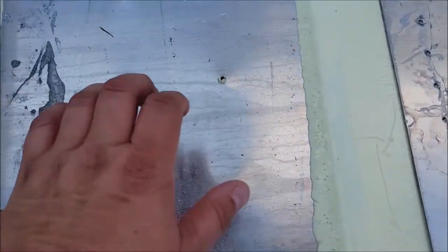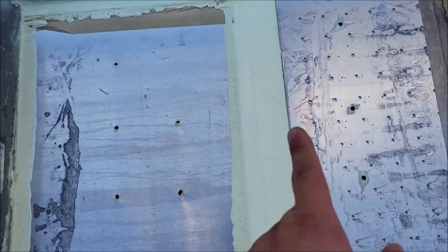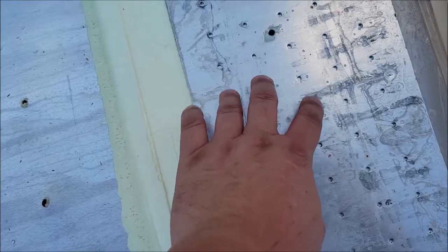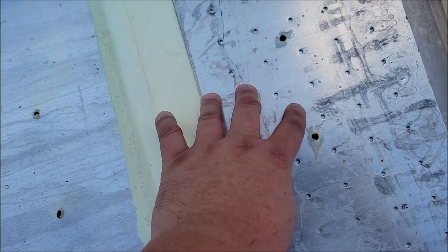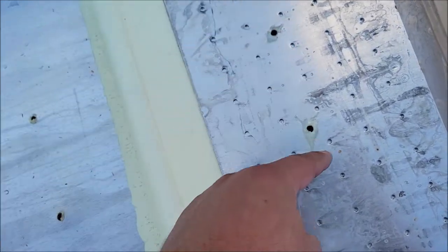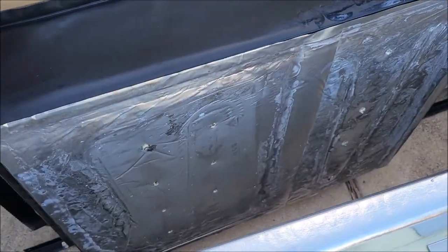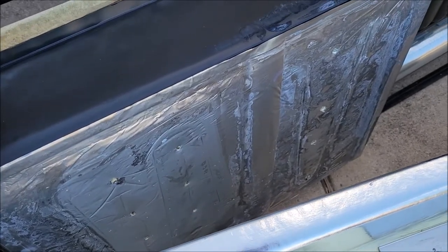There's a metal plate here — that's the metal for the freezer. So this section this way is the freezer, and this section down here is the fridge. When you look inside the refrigerator, you see that metal grate at the very top that usually collects ice — that's this. There are a few screws that go in here because this is what transfers the cool into the refrigerator.